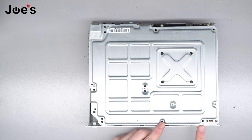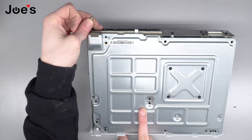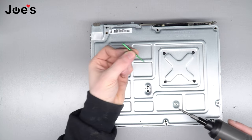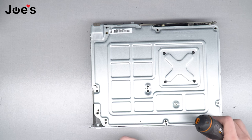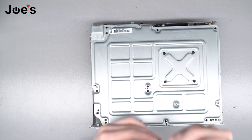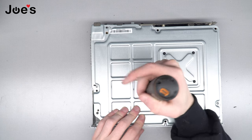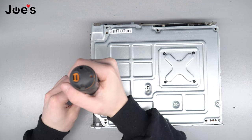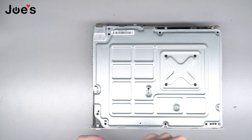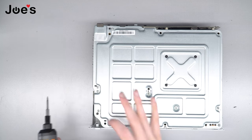Little tip — see how this says F4, this says F3, and this says C3 right here. The F screws are these big green ones. The F screws are what go in these deep holes because it holds the whole console together. The C ones are these little tinier silver screws. Don't tighten them too fast because you might strip it, but nice and tight. Just pulsing this so I don't accidentally strip the plastic on the caddy. Of course if you're hand tightening it, just tighten it normally.